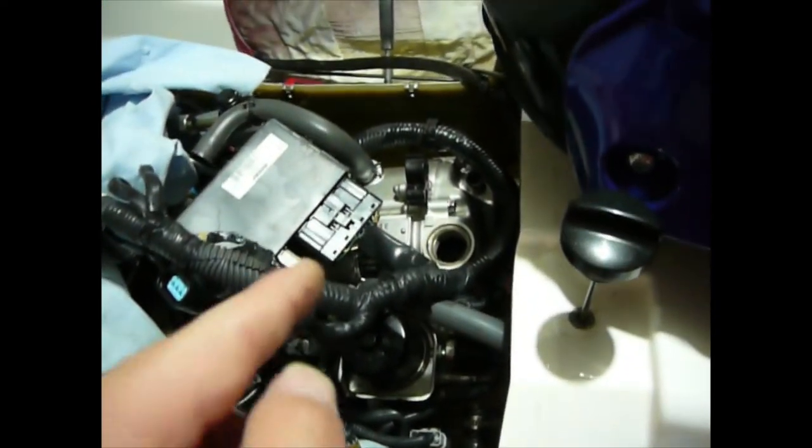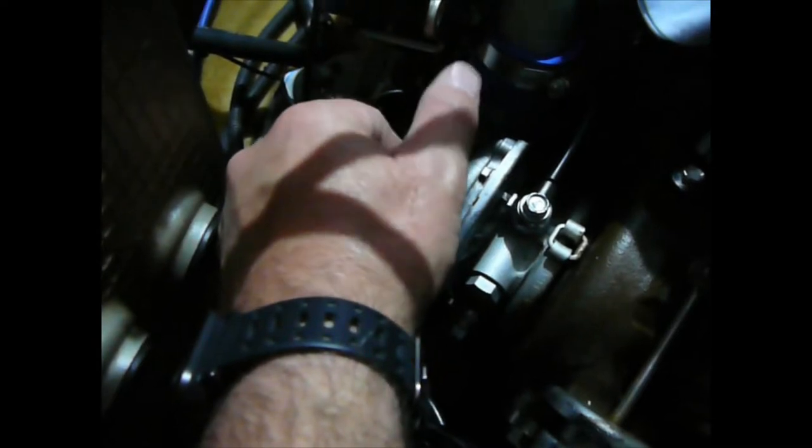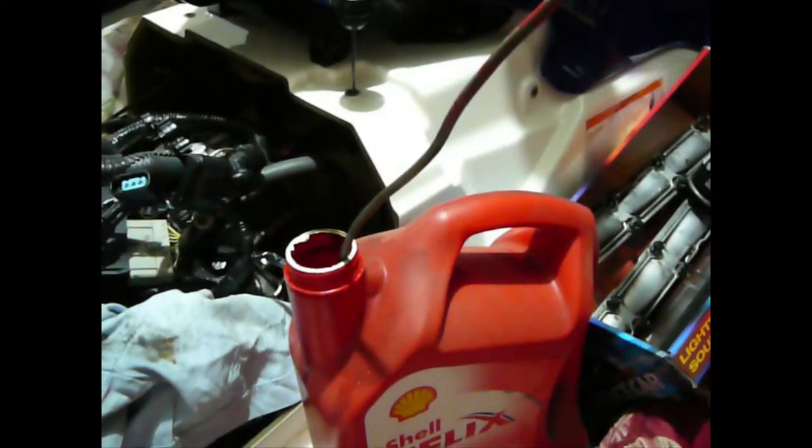The metal tube allows you to get right down to the bottom, which is quite handy. Then you go around to the back of the motor — pretty well everybody with an Aquatrax knows the little bit that's down in there at the back of the motor. Unscrew that and extract the oil out of there. On this particular model it's just underneath the turbo area, where you'll see a little black cap that you unscrew. Again, you can use the syringe method to put the tube down and suck all the oil out.